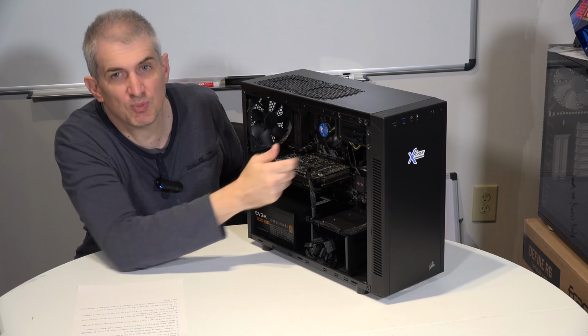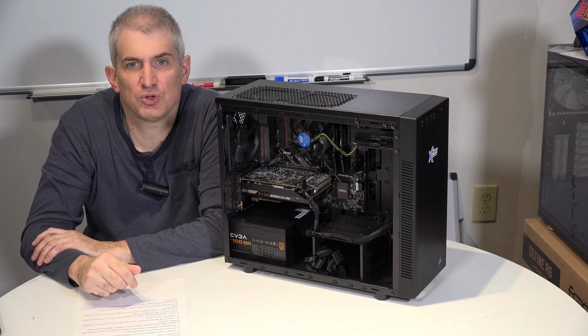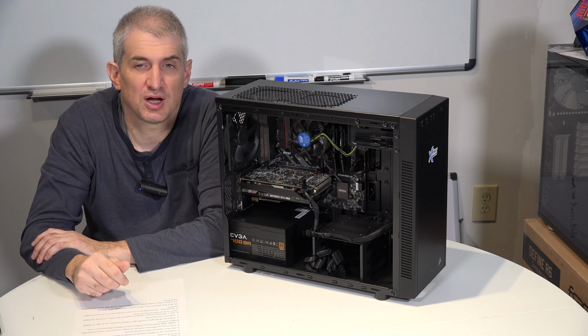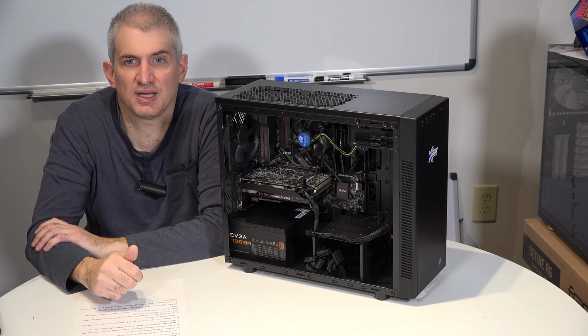And then you have 2 memory slots open. That way, if 6 months, a year, 3 years down the road, you want to put in 2 more 8 gig sticks or 2 more 16 gig sticks, you can. And the system maxes out at 64 gigs of RAM instead of 32 gigs of RAM, which you find, again, on the more budget-minded motherboards.